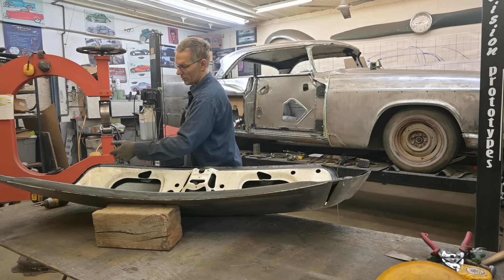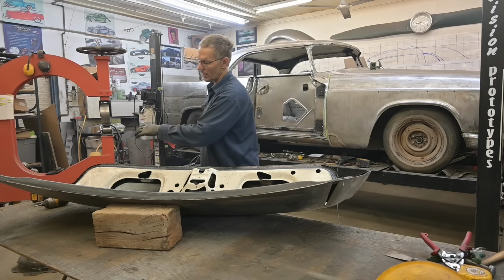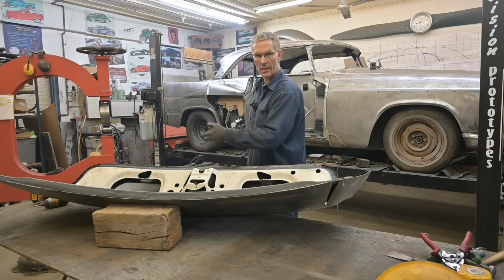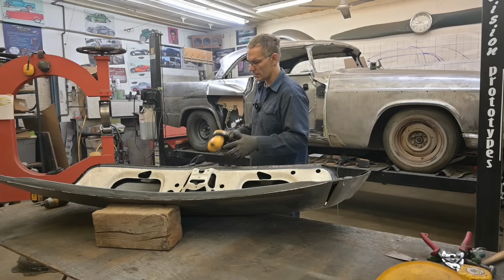Especially with 18 gauge, you won't get a very consistent edge if you try rolling it up, rolling it up, rolling it up. So we're going to do the length down first. Then the second pass, third pass. At the 100th pass, maybe 99th pass, we should be there.